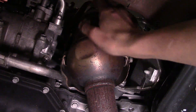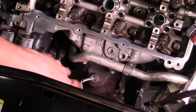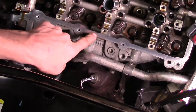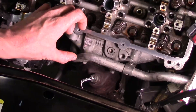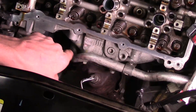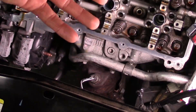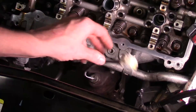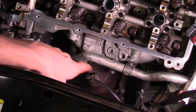Now we've got access to the catalytic converter and to the bolts up top that will help us get it off. Viewed from up above, there's a total of four 10mm bolts that hold it attached to the cylinder head. The bottom two don't go through the catalytic converter — they're part of a bracket that sandwiches and clamps the bottom portion to the cylinder head. So we need to take the upper two 10mm bolts completely off, then back off the bottom two a few turns to release that clamp. We also need to make sure both O2 sensors are unplugged — one was unplugged when we took the main harness off, and there's one further down that we need to unplug before we can get the catalytic converter off.